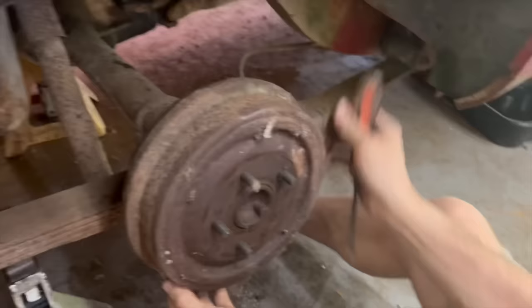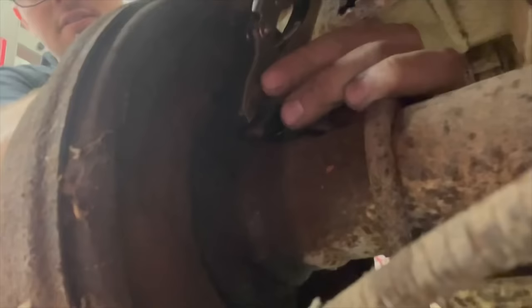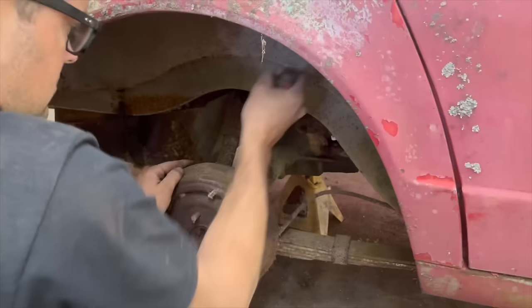So apparently with our wheel cylinder, something's hanging up. I may just go ahead and unbolt the wheel cylinder to give it freedom to come out. Surprisingly, this driver's side brake line is coming loose without any issues. Now, the passenger side one, the nut is completely rounded off from the last guy. So I might have to try to get some vice grips on it or something. We'll probably have to put a new end on it at least. So this one here is totally stripped out. I've got it loosened up with the vice grips. We're gonna see what kind of shape this thing's in when we get it out. I'm just breaking loose the 7/16 bolts that hold the wheel cylinders on. A lot of rust going on at the bottom.